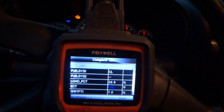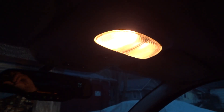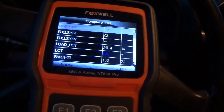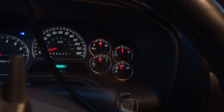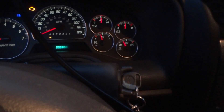I want to go ahead and try to get this in. I thought I'd do a little video here and we'll see if it's any different than the Trailblazer — probably not a whole lot of difference. This is something I really wanted to get fixed. Other than that, everything else seems okay, although I think I need an alternator because when I let up on the throttle, watch those lights dim and flicker. That's a very common issue on these Envoys and Trailblazers with the 4.2 inline six-cylinder engines.